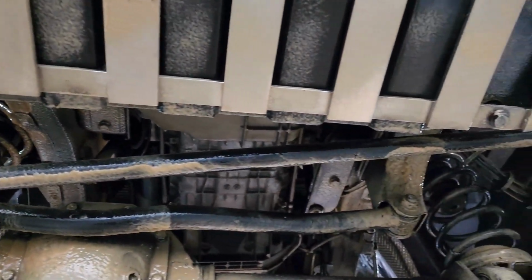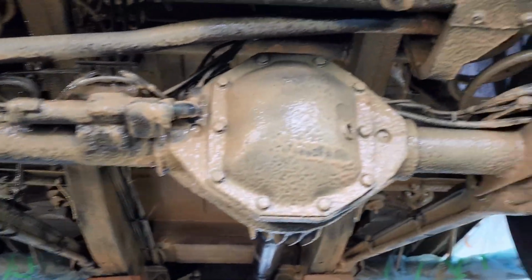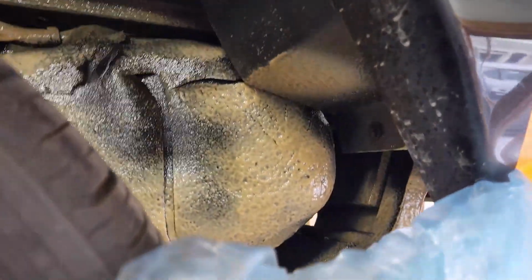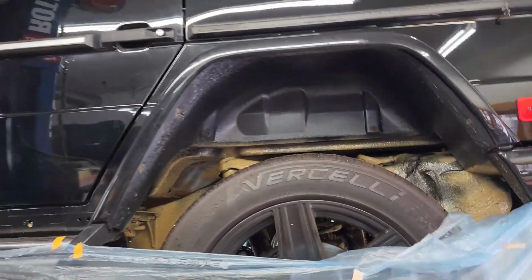And then we've even put some on this front little skid plate here, and up on the steering box. Really just done a very thorough coverage, and of course enclosed areas as well, like inside the frame, all these little holes in the frame. We've put our special tool in there, which is kind of like a long, thin rubber snake with a little metal tip on the end to inject it. And then I will note as well, if I go back out here, this rear bumper structure area has all been coated very thoroughly, and all that cleaned up very well once we got all the loose rust off of there.